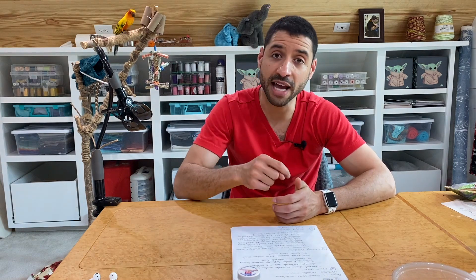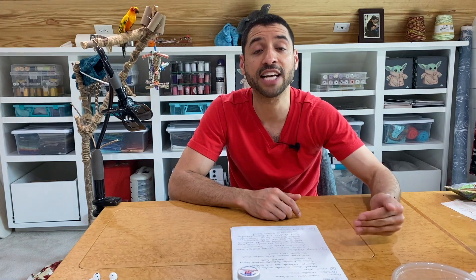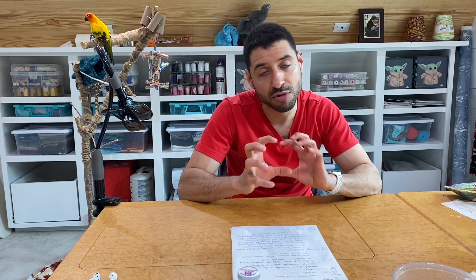When you first turn on the machine, it performs a systems check — making sure every component can move just enough to confirm everything's working properly. The same thing happens when you first start sewing: the needle comes down, makes all its adjustments. That's usually when you get error 1010, either at startup, first sewing, or after changing the bobbin, cleaning the machine, or rethreading — if something wasn't threaded properly and things get locked up.